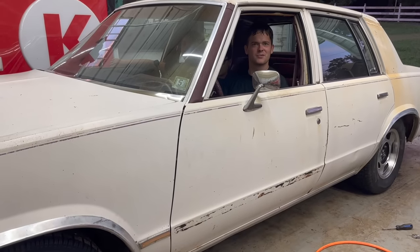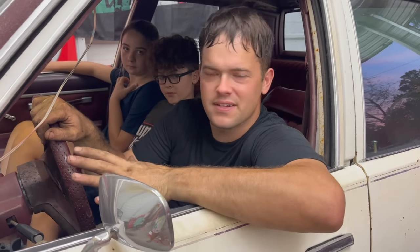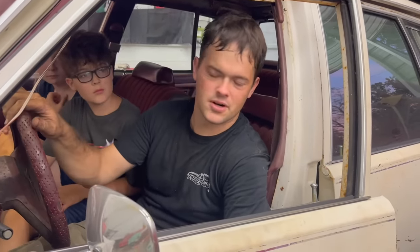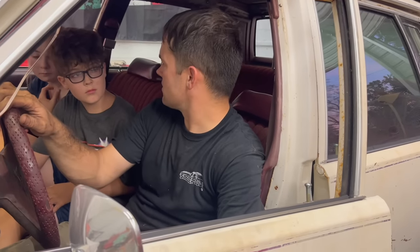I'm excited and I'm a little bummed. It did burn out, but it'll only do it on the two-barrel because the Quadrajet's not adjusted right — we can fix that pretty easily. But I hate that the brakes aren't working good. I guess we should have just put a master cylinder on it. If you're going to do a burnout car and you're holding it wide open all the time, you're not going to have any vacuum, so I feel like manual brakes would be the way to go.